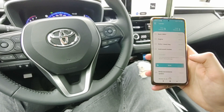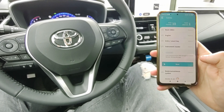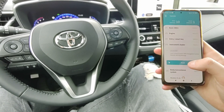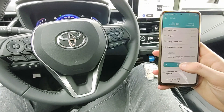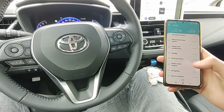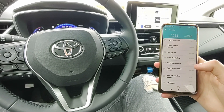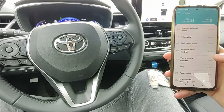I'm curious what fault we have. It found: lost communication with navigation control module. I don't even have navigation in this car, so I think we can reset it — and yes, it erases it. Because it can scan all of the control units, it is worth the price. Carista is really cheap, and if it can do some customization this is really a great tool. Also it is scanning pretty fast.